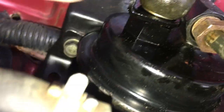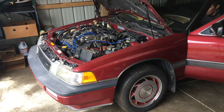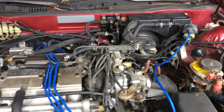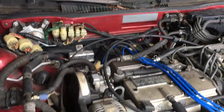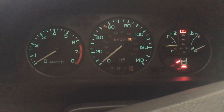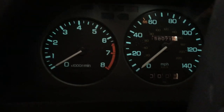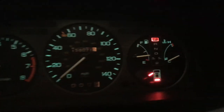With the battery hooked back up, cycle the key a few times to prime the fuel pump and build pressure. Then go take a close look at all the injectors and banjo bolts and make sure there's no fuel leaking — just to make sure you didn't miss anything. Oh look at this — looks like I have a small leak at the fuel filter. I'll tighten that a little more. Now with the engine running, check everything one more time. If you can smell any gas, shut it down right away. This Legend runs 100% better now with new injectors — here's a before and after comparison.